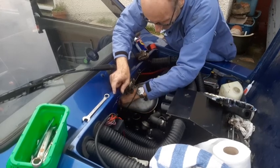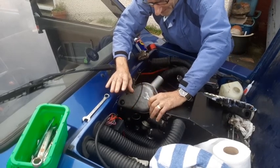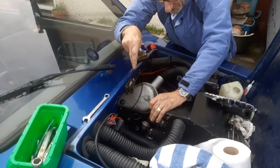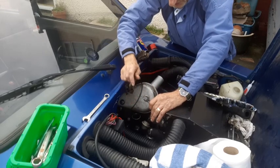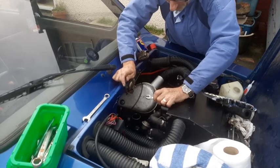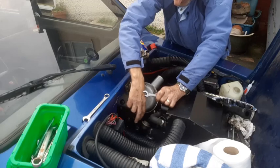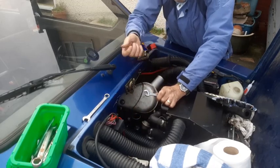Don't go mad. So what I say is spark plug now. Don't go crazy. When you put a spark plug in, just screw it up with your fingers and then just give it a pinch up. That's all you need. You don't need any more than that. I had to sort the plugs out on this, and I think they've been put in with a crowbar or something. It's ridiculous. And trying to work on them down here, you can imagine, can't you? You've got to take the side panel off anyway. And this one is an absolute pain, even though it's at the front and it's right near you. Unless you've got the correct spanner to get in there, a multi-adjustable one, where you can get the shaft to come out and give it a bit of leverage, you can't get the bugger out.